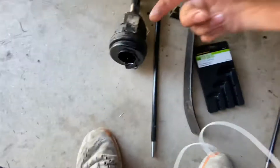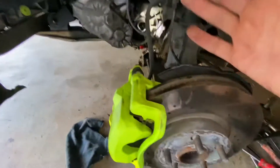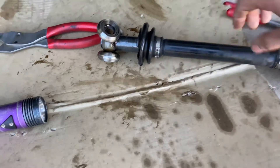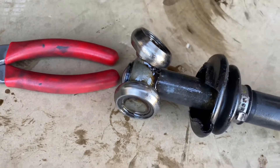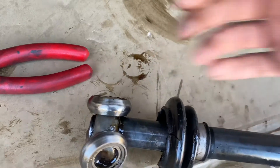We'll start rebuilding this side of the axle, put it back together, and start prepping it to put on the boot. When you take out the axle, be very careful — there might be some spillage from the tranny fluid, so have a pan underneath. You can hammer a small flat-head screwdriver right here and move it around until this pops out. Once you take off the boot, you can hammer out the outside cup — just grab a sledgehammer and tap it, and it should come right out.